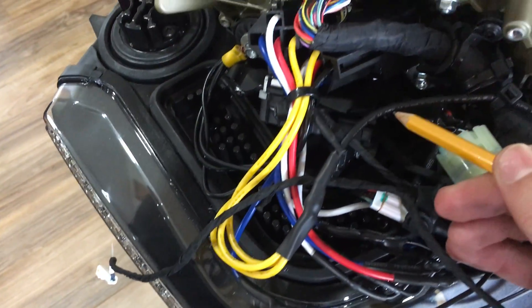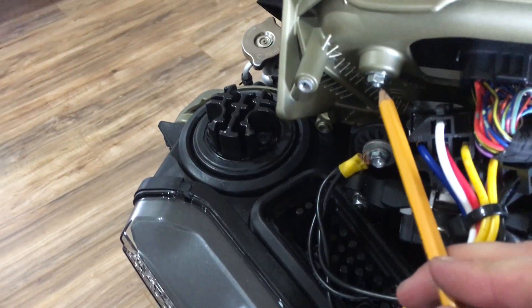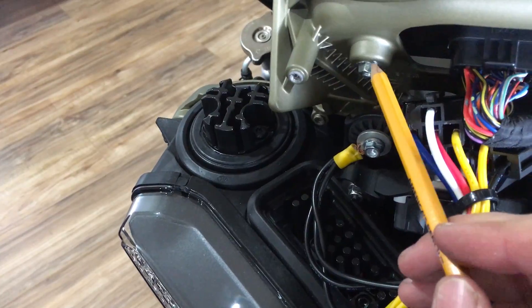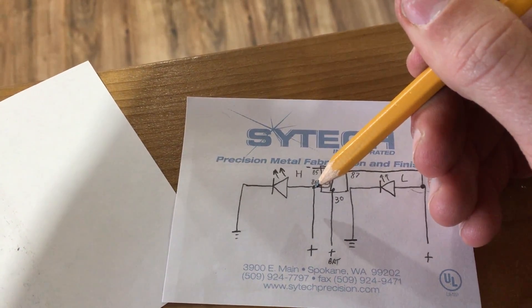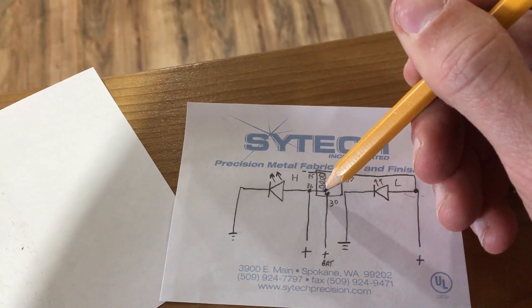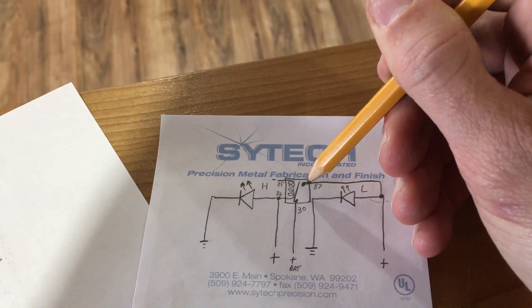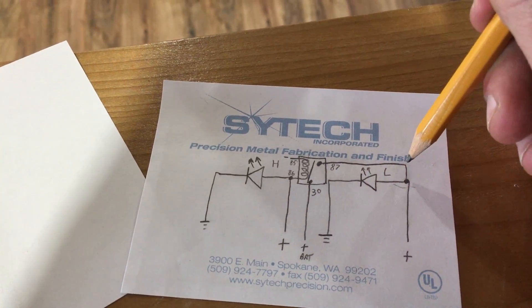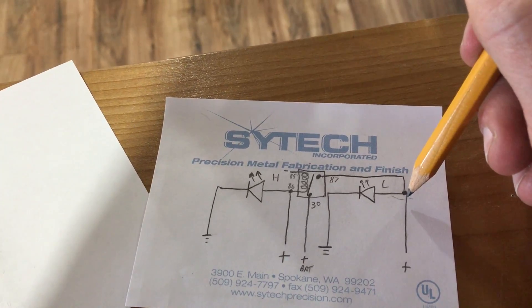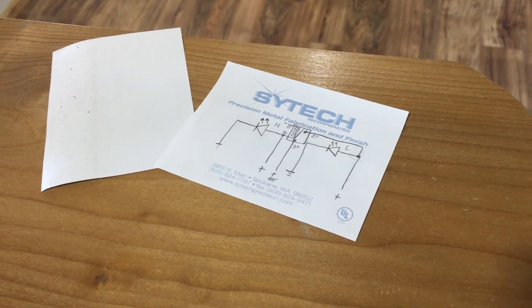I ran in 12-gauge wire to power my relays and then just tap in right here for your grounds. How it works is positive directly from the battery coming in on pin 30, and then you pull the positive — the yellow wire — off the high beam, and that goes to 86 on the relay. 85 goes directly to ground. When you turn on your high beam it'll charge this electromagnet and switch it on. You don't need 87A on this one. That'll connect the battery directly to your positive. The bike will shut off its low beam when it turns on the high beam, but you're going to turn it back on with the relay. So you can turn on the high beam and it keeps the low beam on, and when you turn the high beam off the low beam stays on normally.